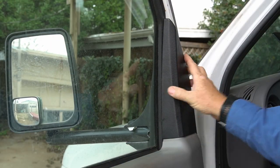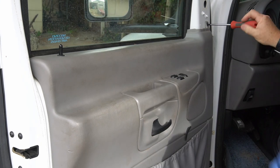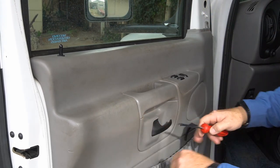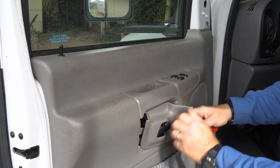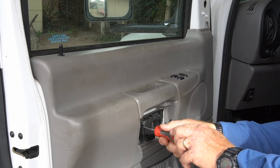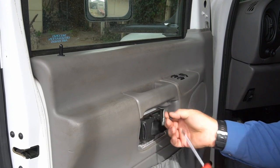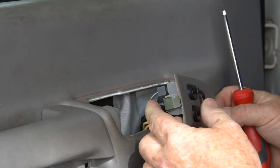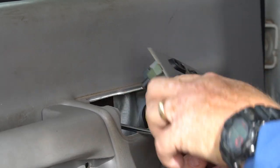The first step is to pull this off — it's just got a little clip spring in there, just pull on it securely and it comes out. We've got one Phillips head screw right here, and then we've got to take this off here. There's a little slot right here where you put your flat head screwdriver in and pry it loose. There's a Phillips head screw in here that holds the door panel on. There's a second screw underneath here — just come in and pry up on this, it's got these little clips — and take that screw out with your Phillips.